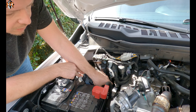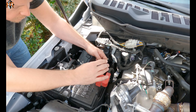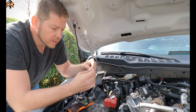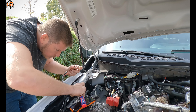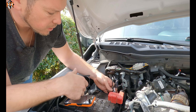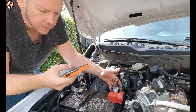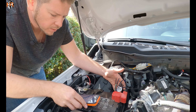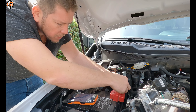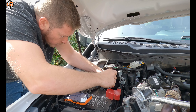On the bottom of the box, this is where you have all your auxiliary connections. Free up these wires — there's also a little legend showing what color wire does what. Remove some of the electrical tape. Go ahead and put an eyelet on the ground wire and use this bolt here to feed the eyelet through for the light bar ground. Now that we have the ground of the light bar on the negative terminal of the battery, pick the auxiliary wire. Looking at the chart, we're looking for a green wire with a violet tracer — that's auxiliary switch number one. Go ahead and strip it and put a crimp connector on.